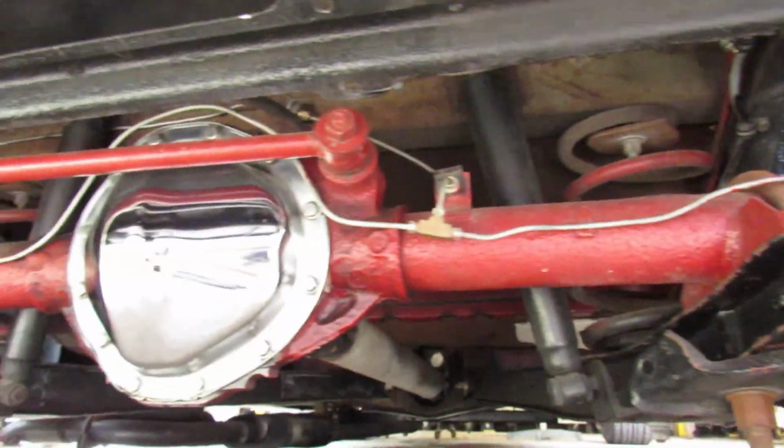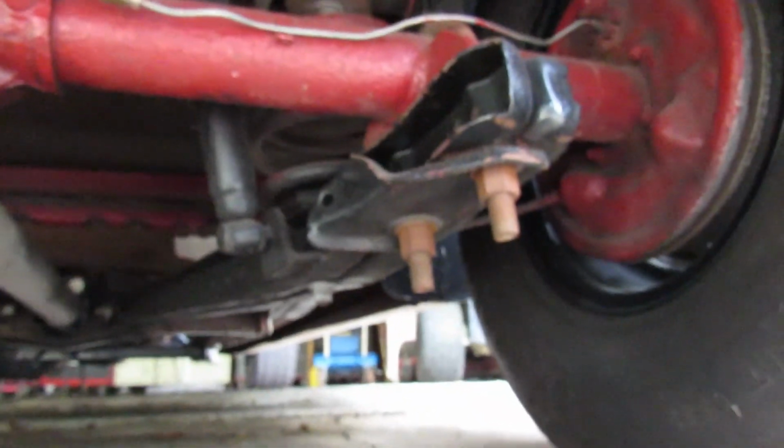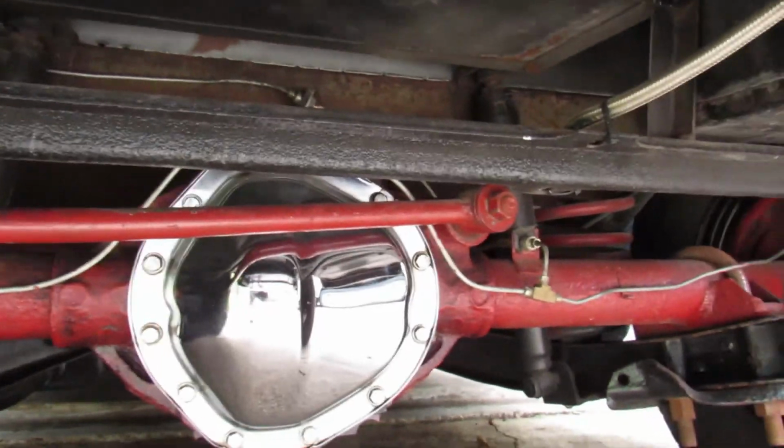The rear suspension is all 1969 Chevy pickup. They got the long trailing arms, coil springs. So I modified that to fit underneath here. I took everything underneath the Chevy pickup, the 6-lug rear end, posi, put that all underneath. Got a panhard rod holding it center-wise, just like I had in the Chevy pickup. Let's see if we can get a shot underneath it. So there's the rear axle. Woo, chrome. I don't know if you can see the trailing arms. Then you got the panhard rod that goes from the axle right up to the frame here.